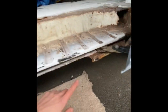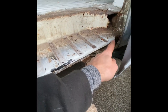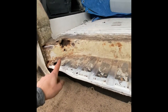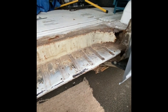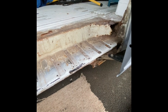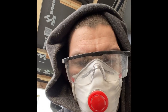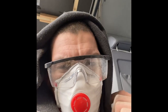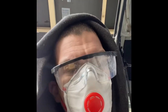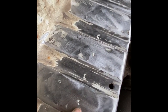There's two on top, one, then one in there, then two on top — that's what holds this on. My idea is to keep the step in situ, try and remove the runner section from underneath if I can. I'm going to have to do some cutting here and some cutting there, see if I can get it off in one piece as much as possible, make a new one, then weld it back up. So let's get started with cleaning this up. Don't forget your mask and goggles, and ear defenders if you have them.